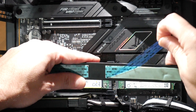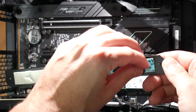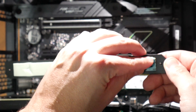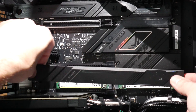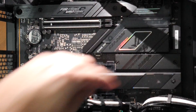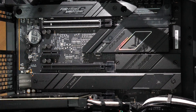On the back side of the heat sink, you need to take off the plastic covers on the bottom of the heat sink. They can be kind of finicky — just take your time. You don't want to pull the adhesive off; that would be no good. Once you've got those off, it's time to reinstall the heat sink over the top of the SSDs. This can be a pain to line up properly, just take your time. The screw holes are very small, so getting it lined up can be kind of tricky.